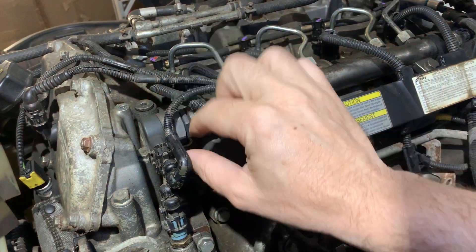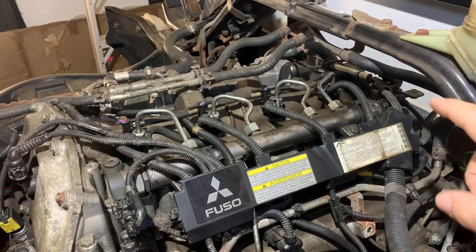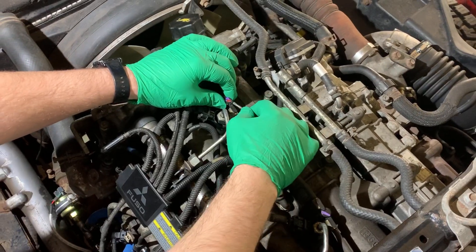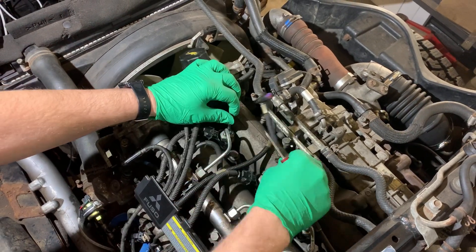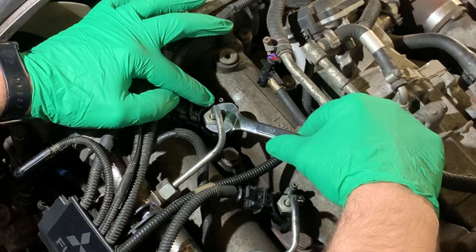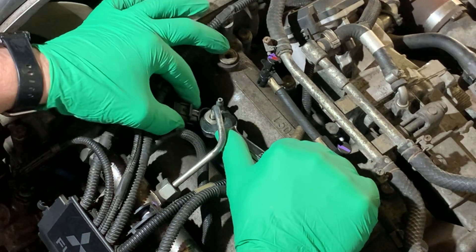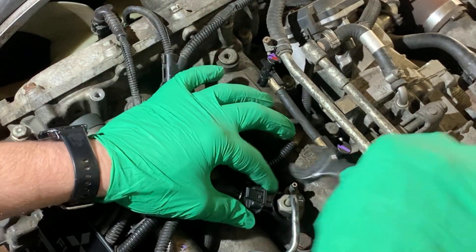The pressure regulating valve is in the very front of the fuel rail and I don't think there's enough room to slide it out once it's undone, which means the rail has to come out in order to change it. In order to get the rail out, all of the hard lines need to come off, and in order to get the hard lines off properly, all the return lines need to come off. Starting with the fuel return line — you may find it easier to get a little screwdriver under the edge. You pull the cap up and then these pop off. Next you want a 17 millimeter, ideally a crow's foot. Be really careful when you turn this that you don't ram into the fuel return line — it's a little tricky because the other side is ramming into the injector plastic housing. You just need to loosen these off; I'm not actually going to remove these from the injectors, we just need it loose so we can move the other side.